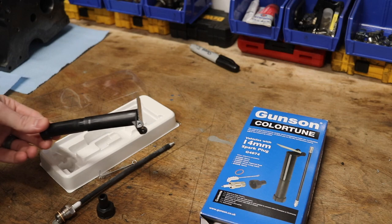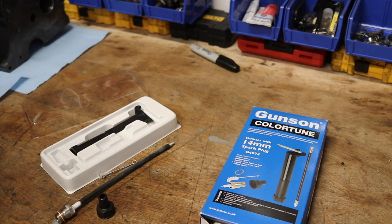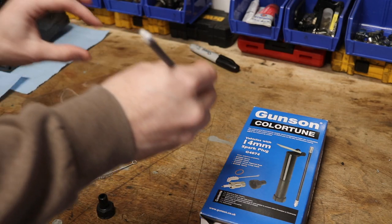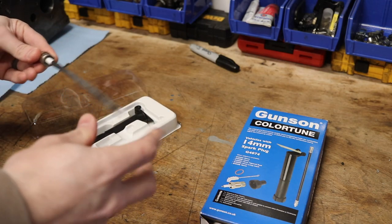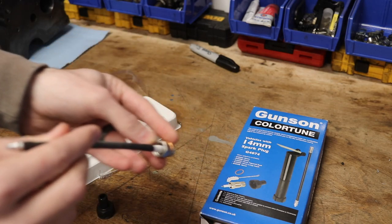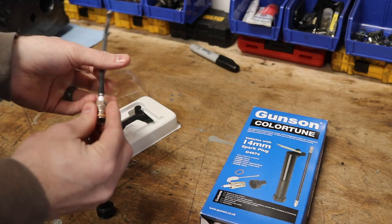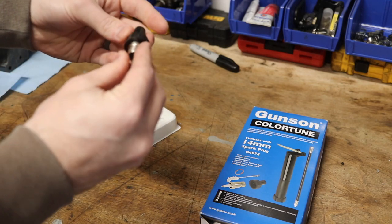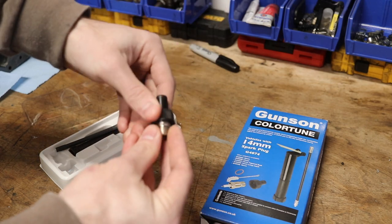For our Minis, it's going to be pretty easy because the spark plugs are right on top of the car. Now, even though I have dual carbs, I only picked up one of these kits. If you have dual carbs, it's going to make it considerably easier to tune and synchronize them — if you had two sets of these, you could install one on each side to tune each carburetor and synchronize them much more easily. In my case, I'm going to have to do one side and then go over to the other and switch them out. The kit also comes with a little adapter that goes over your Color Tune, and then you put your normal spark plug socket right over the top so you can actually screw this in.